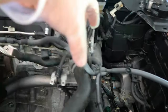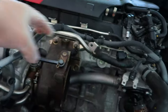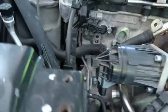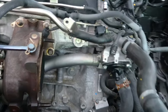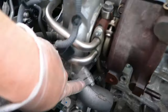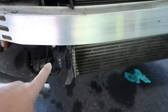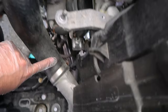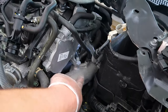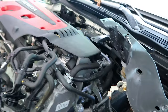The intake runner goes right over the hot turbo — you can see the clips there, that's where the intake runner basically installs itself back to the cold side of the turbo. After the cold side of the turbo, it goes through here, down through this charge pipe, and into the intercooler right down there. The intercooler is right there — plastic runners, small intercooler. Then there's the post-intercooler pipe that takes the turbocharged, high-pressure air to the back and into the engine.